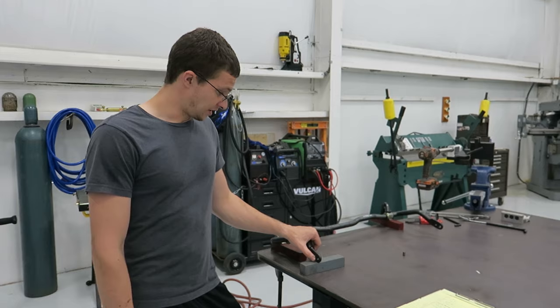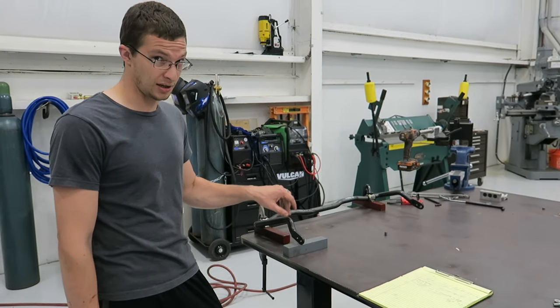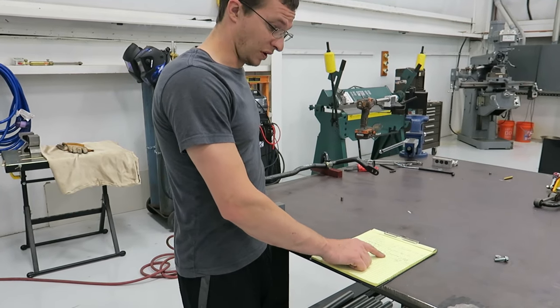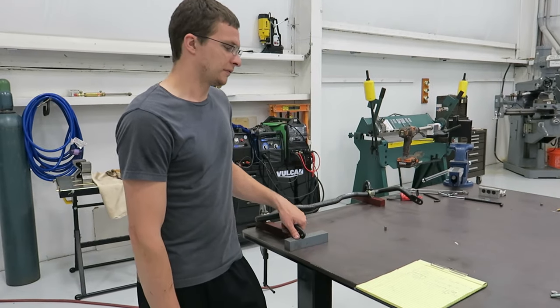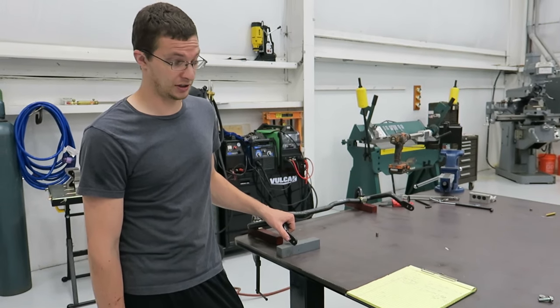That just about wraps it up. I did get the 24mm bar up on the bench and gave it a quick rate to compare — this one that came on the GTS4 car came out to 220 pounds per inch of travel. The 24mm is definitely a bit stiffer than the Ground Control bar, but not by a ton. Still waiting on the 18mm bar to come in. That's it for today's video — Robert went to a WRL race in Hastings, Nebraska and got some fun footage that'll be up shortly, and we're prepping for a July 4th event at NJMP. Make sure to subscribe and leave a like — thanks for watching!